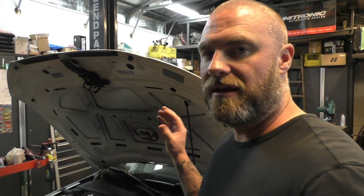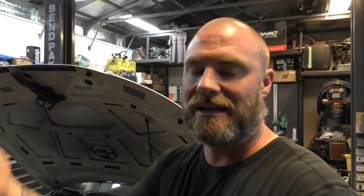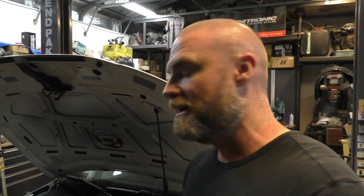Install's done. The entire system's been bled and seems to be good to go. Now I'm going to get out there and do an after log — obviously not tonight, it's a late night here at Rider Performance. The next day I'm available to do the log, I will get out there, make sure the ambient temp is roughly the same, do back-to-back pulls like I did previous to the install, and see if this pump makes a difference.